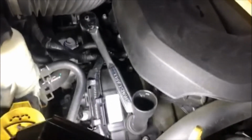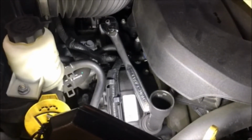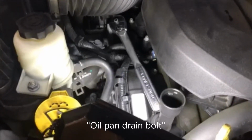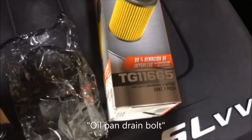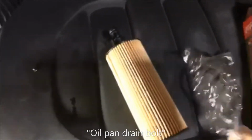Okay, we're back. We're up top now. Don't forget to put your drain pan bolt back in and snug it up good. Got all the oil drained out. Getting ready to do the filter. This uses one of those newer cartridge type filters. This one is Fram part number TG11665. Again, I'll put a link in the description. Comes with a new O-ring that goes on this cap, which we're in the process of removing.